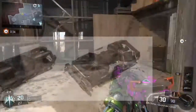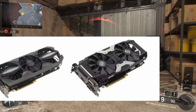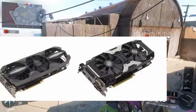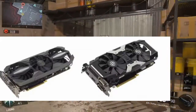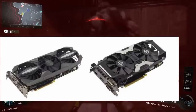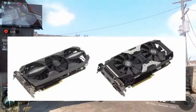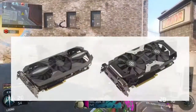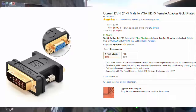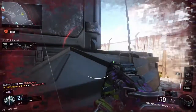Lastly, we have two more Zotac models. The one on the left is my favorite of all the pictures in this video — it's the GTX 1060 PGF, and it looks to have a matte paint finish with cool looking fan covers; I really like it. The model on the right is the Zotac GTX 1060X Gaming Edition. Something interesting to note is that it has two DVI outputs, unlike the others we've seen. Most likely these are DVI-D and DVI-I dual-link, so we'll still be able to use VGA monitors with a passive adapter. If you don't have one, they're cheap, as you can see on Amazon right here. This is the first time that's been pictured on a 1060.